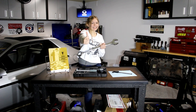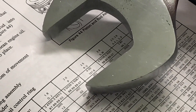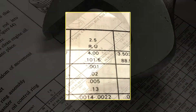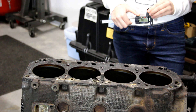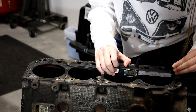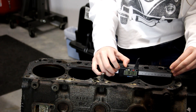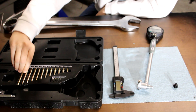Let's get started! Before I do any measurements at all, it's important that I first identify the baseline for this engine when new. I reference this in the factory service manual and identify a 4-inch bore, or 101.6 millimeters in metric, for the Iron Duke. I'll then take my metric caliper and confirm my standard bore size of 101.6. Note that while my engine has wear, the top of the engine bores are untouched and should still have the factory measurement. I measure 101.6, which means the engine has never been previously bored and likely never rebuilt.